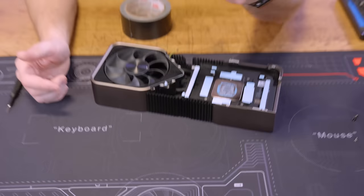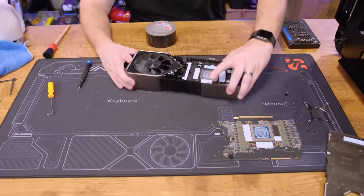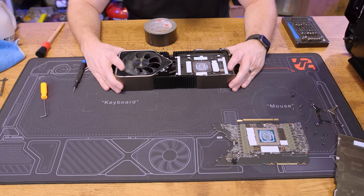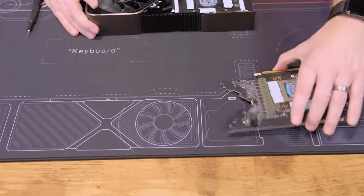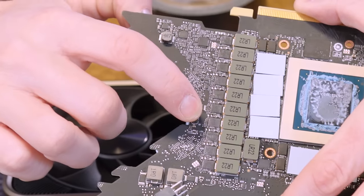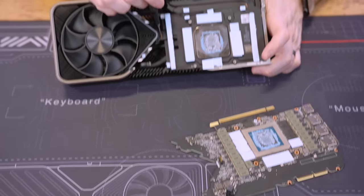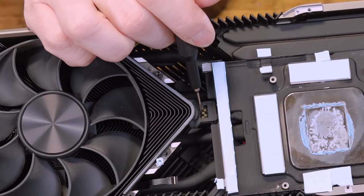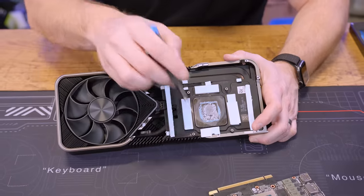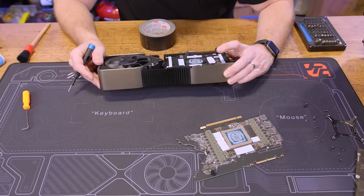It's also funny how small the PCB actually is. I'm glad I took the cooler off because that tells me there is a benefit to me doing this. Be careful too if you're playing with a Founders Edition cooler — these are contacts, spring-loaded contacts for the lighting. They push down and contact right inside there. So if you take this off sideways, you could bend those and then they won't retract properly, they won't make contact, or they could bridge where they shouldn't — and then bad stuff happens from there.